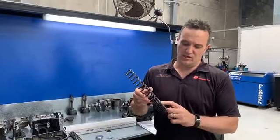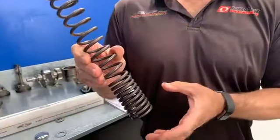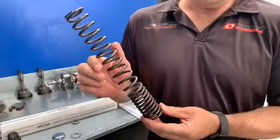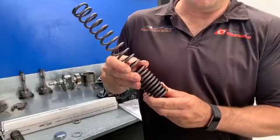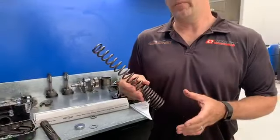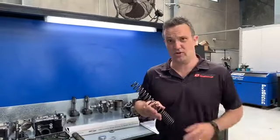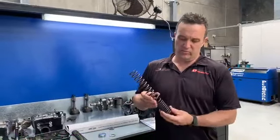So what they're saying is the closed coils here, which are the softer part of the spring preload, and then it progressively gets into the firmer part of the spring. But what really happens is these coils close up. See, look how easy they are to close up on my hand. The right way to set suspension up or have good control of your front end or rear end, the rear end's a little bit different. You've got to think a little bit different with the rear end when we're talking dual shocks, but you definitely don't race a bike with progressive springs in it.